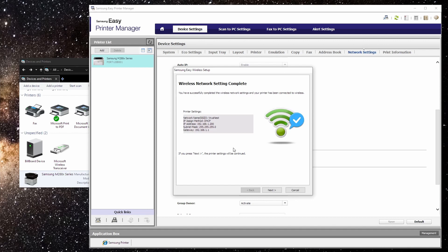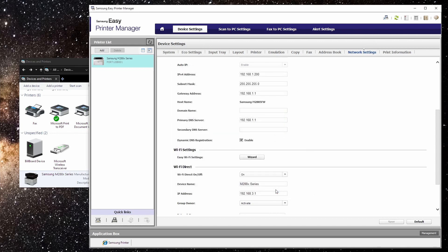Previously it didn't work, but this time it seems to work. You need to be a bit technical here. You can see there's an IP assignment — DHCP IP address 192.168.x.x, which is typically the home IP range. Previously during troubleshooting I was getting an IP address like 169.254.x.x, which will not work. When the IP address is in the correct range for your home network, it should work.